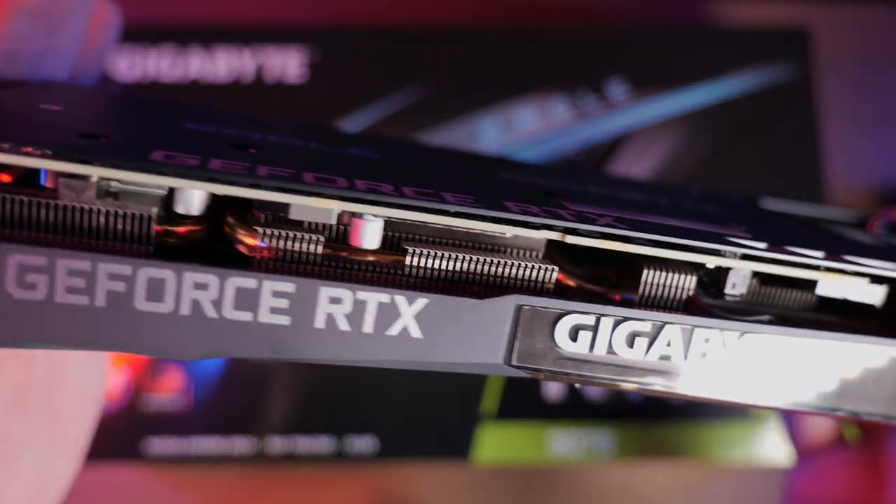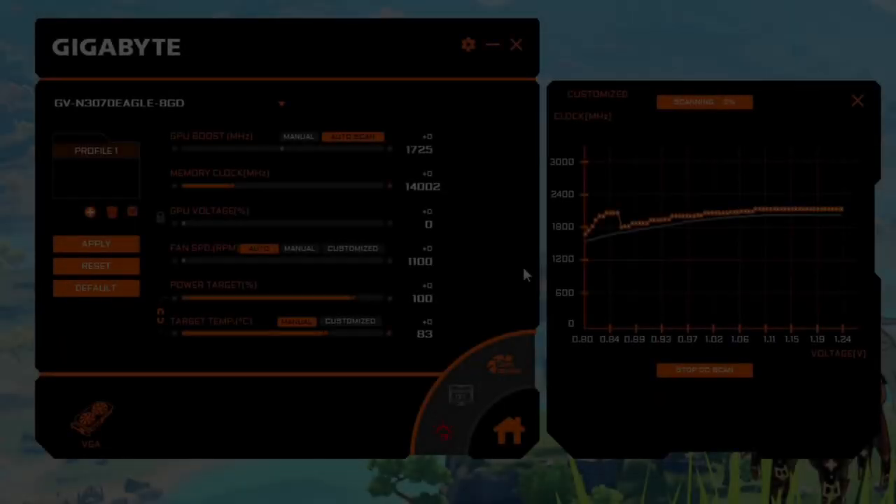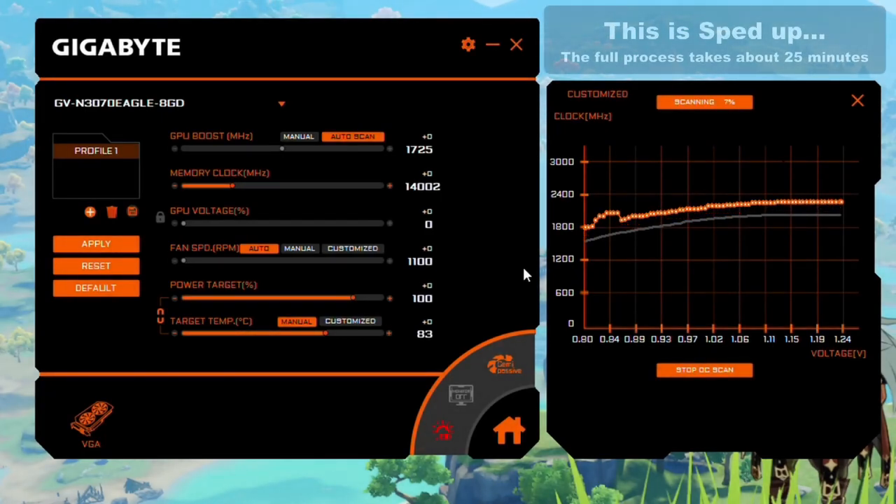But that was with a manual overclock. So firstly, let's have a look at this. This card, like its entire family, regardless of branding, has the ability to go through an automatic process of testing to determine a power and speed curve specific to that exact card. The process is one click. It might look slightly different depending on the manufacturer's own software interface, but it is entirely safe and will lock in a nice boost for your performance versus out of the box. Think of it like a fine tuning process for your particular card. So if you're nervous about overclocking, just do this and you will get some free speed really quickly and you don't even have to know what you're doing.